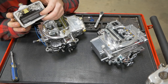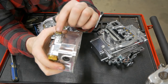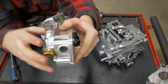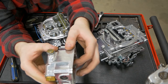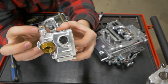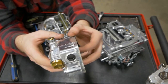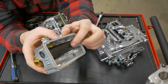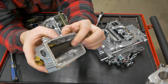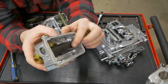This is the fuel bowl with the adjustment here. Fuel comes in and fills this, then the float rises up and presses a needle into a seat — it's called the needle and seat, it's under this screw. As the float rises up and plugs that seat with the needle it shuts off the fuel flow into the carburetor. You use gas, the float comes back down, and it fills back up.